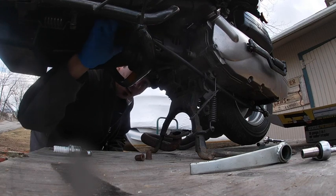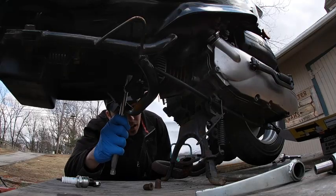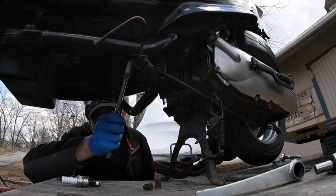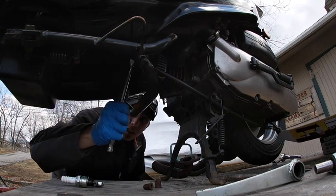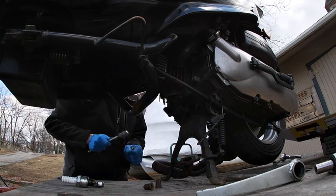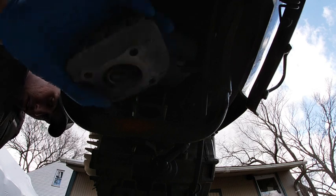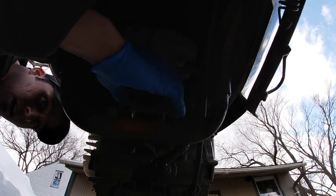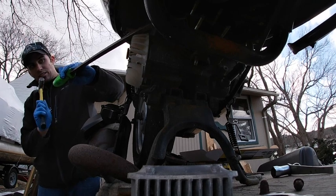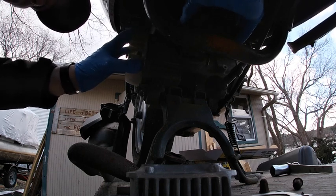There's a top bolt and one down below on the carb bracket — just remove them both and let the bracket dangle. Next, this plastic cooling shroud — all the air from the fan passes through it, take that off. Next crack all four of your cylinder head stud nuts — 10 millimeter, not on there with a ton of torque, just get them loose and spin them off by hand. The cylinder head comes off with a little bit of wiggling. Behind that you've got your cylinder head gasket — aluminum. Whack the cylinder lightly and it'll pop right off, breaking the seal on the gasket, then slide it right off.